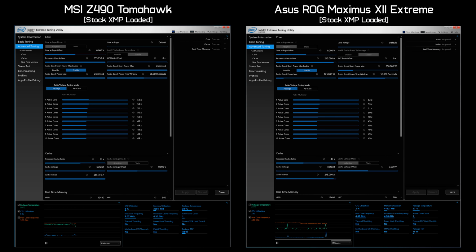The 10900K provides a 27% performance boost over the 9900K in the V-Ray benchmark, and while that meant it was 30% faster than the 3700X, it was still 13% slower than the 3900X. We see that enabling MCE does boost performance by a further 7%, but you can also boost the 3900X by a single digit figure as well by using PBO. Here we see that the 10900K does quite well in the Corona benchmark, and with MCE enabled, it was able to match the 3900X, so there is that. Stock, however, it was 10% slower.